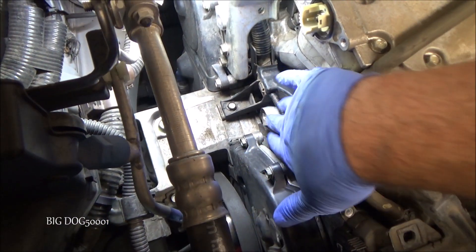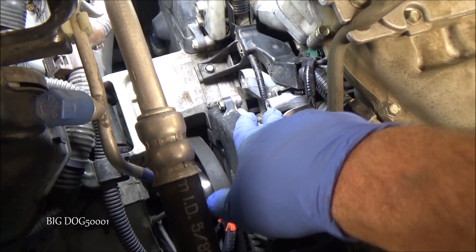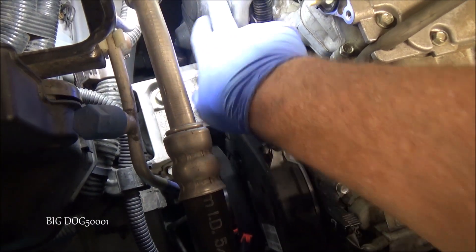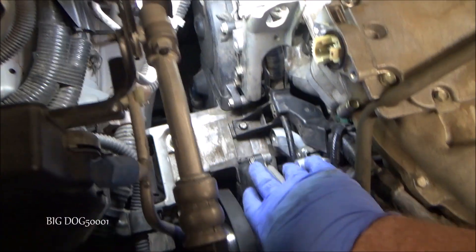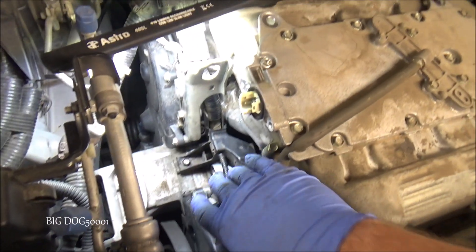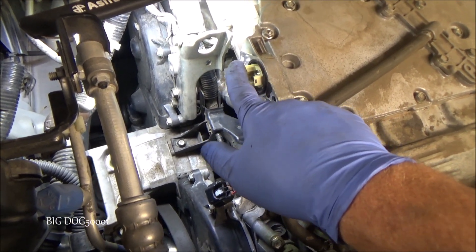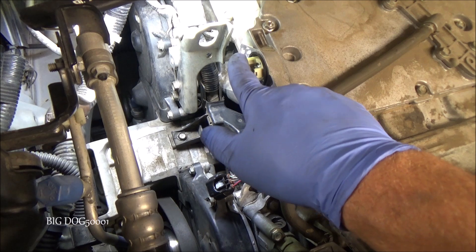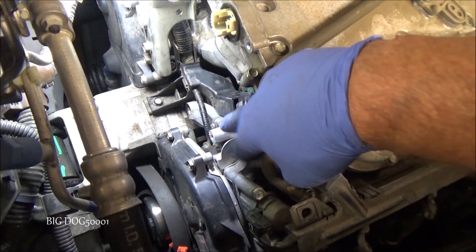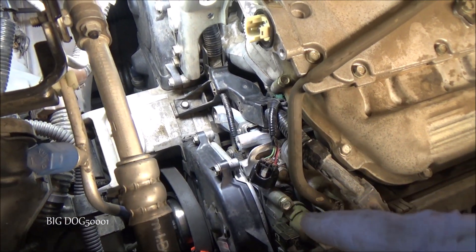Now we just make sure our wiring harness is out of the way. There is our extra area for the third bolt, and then of course this one and this one are the ones we already took out. So now we've got one, two, three when we put it back in. We also want to make sure we don't knock the actuator around — if it sets a trouble code if it's in the wrong position, we'll take care of it. And then we just have to make sure we don't pin the wiring harness when we put our power steering pump back in.